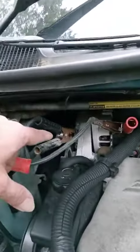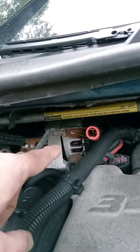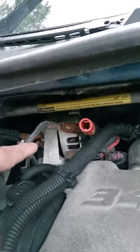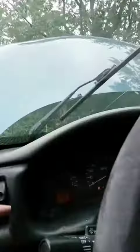And it's on the negative too. I got the negative on the negative post. You can reference the jumper cable — it's got the hot wire on the positive, got it grounded right there on the alternator, and got it on the power cord for the alternator. And it's plugged in. So that seems to be the problem with the battery light coming on — that seems to be what was doing it.